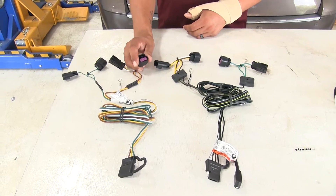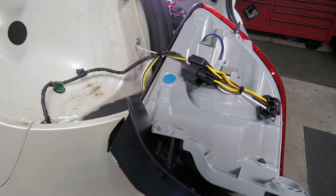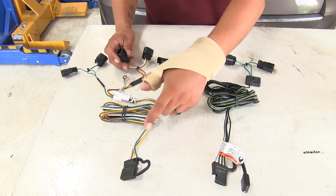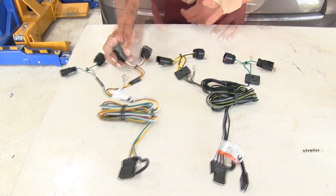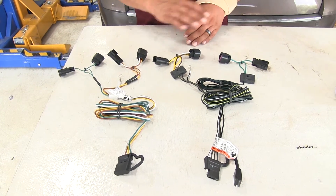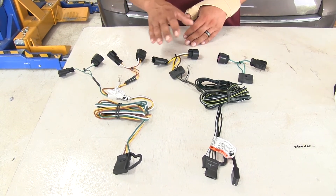It's going to have one end that plugs from the harness from our vehicle, and then the other end is going to plug directly into the tail lights. So it's just going to be like an inline circuit, so our tail lights will still work, but there's also going to be power going out to our connector. Both of these are going to be an extremely easy installation — we're not going to have to run any extra wires, do any kind of cutting or splicing.